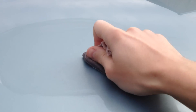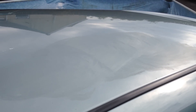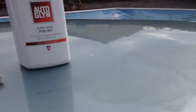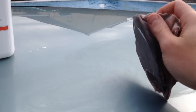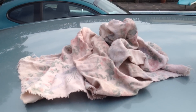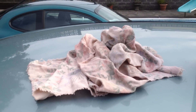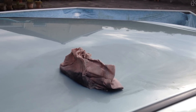You want to use some force when applying this - the more force you apply, the better the finish you'll get. That's about enough polish to do an area roughly that size. Leave that to dry to a hard haze, which will take about two minutes, and then buff it off with the off cloth. Putting the polish on with the on cloth is the hard part and takes some elbow grease. Taking it off with the off cloth will be very easy. Repeat the process several times until you've got a nice mirror finish on your car.